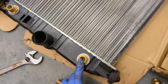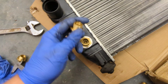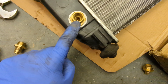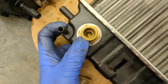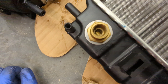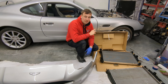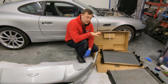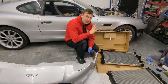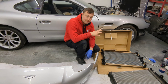Terrible news — the Aston pipes don't fit the Jag rad. It does come with adapters and the Aston part does fit in there, but it's the wrong fitting so it won't screw in. Basically it will fit if the bottom hole was a little bit bigger. That is 11.8mm at the bottom versus about 10.5mm on the Jag rad. So if I drill that out to 11.8mm, the part will fit in and screw in perfectly. Bit risky, but it's worth a go. I've ordered the drill bit — it may work, it may not. I'm a little concerned about swarf getting inside, so I'm going to try and cap it the best I can. If I'm not happy with it, I'm going to have to bite the bullet and buy a genuine Aston Martin one.